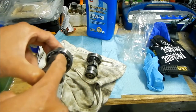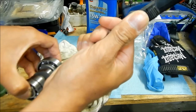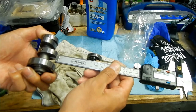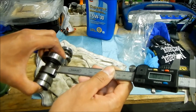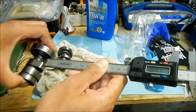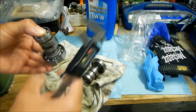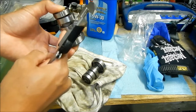What you also want to measure is the height of just the lobe itself — not the whole cam. The new cam lobe height measures 12.6 millimeters. The stock one measures 11.5 millimeters. So it's almost a millimeter taller for the lobe alone. However, if you measure the whole lobe it's actually shorter — so that might be how they achieve higher lift while the other side is shorter.